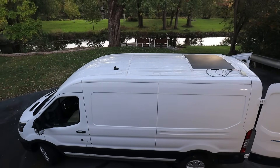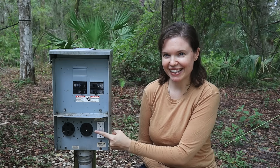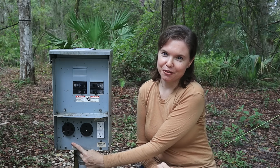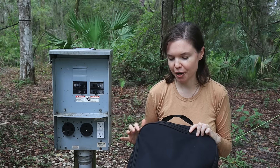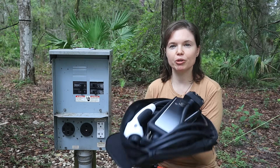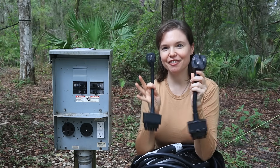She requires a lot of charging, and a campground is a great and inexpensive way to charge your vehicle. I'm going to show you how to do it using the 20 amp outlet, which is this little one here, the 30 amp outlet which is the one in the middle, and the 50 amp which is all the way on the end. All I'm going to be using is an adapter and the portable charging unit that came with the purchase of this vehicle from Ford. With this portable charger you will have a 20 amp connector and a 50 amp connector.